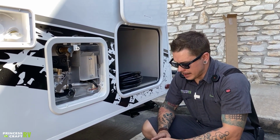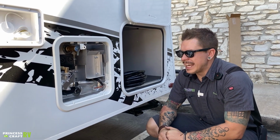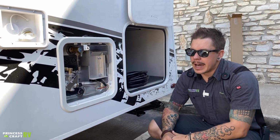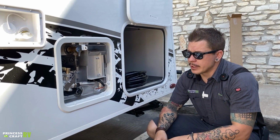It is very well insulated. Once we are fairly confident of the temperature, we're going to then depressurize it. Now we're going to use the hot side of any water fixture within the unit to do so. Whether that's in the kitchen, whether that's in the bathroom, outside shower, whatever, we're going to focus on the hot side of that.